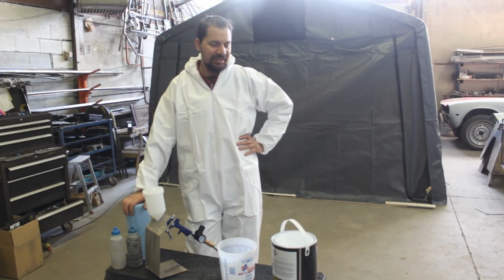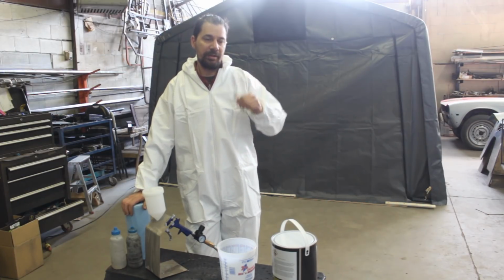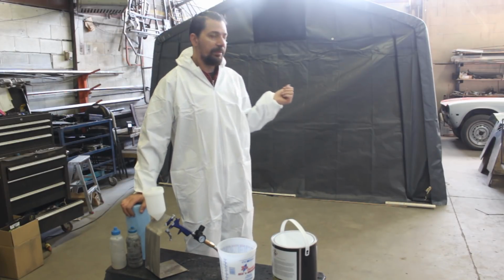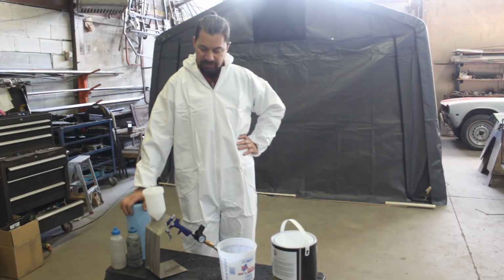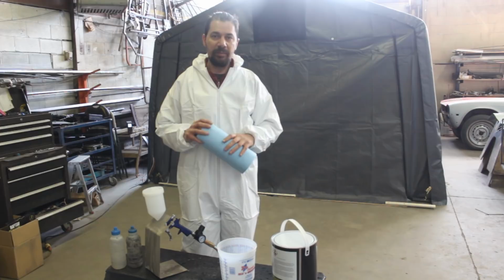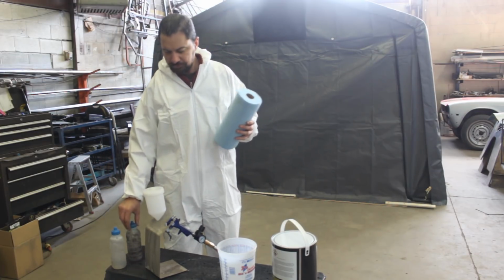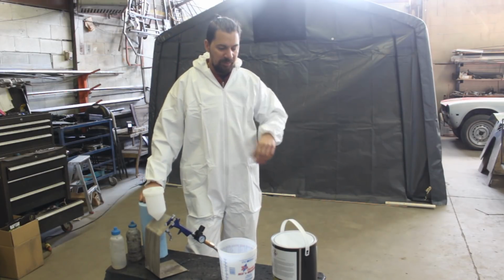Hey, good morning guys. It is Sunday, April 29th, and I'm getting ready now to prime the car. So you probably watched the previous episode and you saw how I built my temporary paint booth. The car is inside, all cleaned and ready for painting for the primer. The last thing to do is I'm gonna go inside now and wipe the whole body with solvent. And then I'm gonna come back out and I'm gonna mix my epoxy primer.